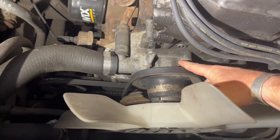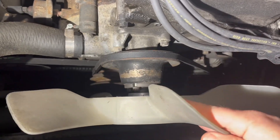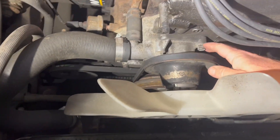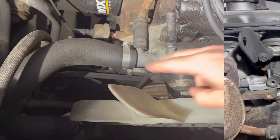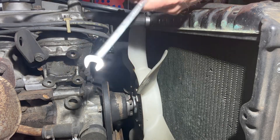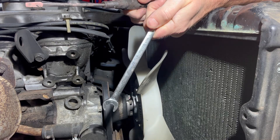Right here, pretty easy to get to on this one. All we're gonna have to do is take the four bolts or four nuts off to get the fan clutch off. There's no shroud so we don't have to get that out of the way. Then I think it's five or six bolts and two hoses. We've got to take the nuts off of the studs that hold this fan clutch on — that'll be step one. We're gonna need a 10 millimeter wrench, assuming you can find one.